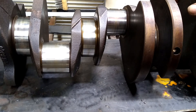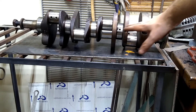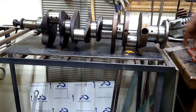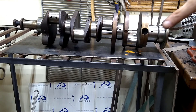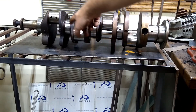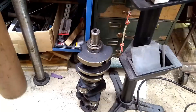But that's really all there is to it — real simple, all you need is a good set of calipers. One last note on crankshafts: do not store them lying flat like this because they've got uneven weight and it can tend to make them droop, giving them a slight bend. A couple of thousandths of a bend is going to make it not turn in the saddles the way it's supposed to — it can cause a bearing to bind and all kinds of problems. So you can lay them flat while you're measuring and doing that kind of thing, but if it's not being supported on all of the main journals, it needs to be upright.